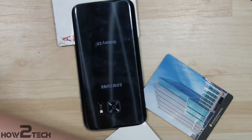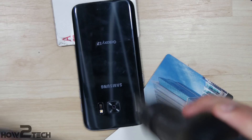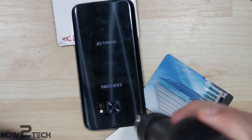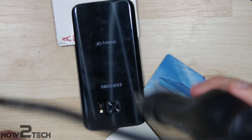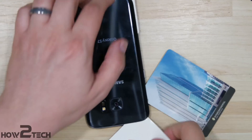Right here there's a bit more adhesive, so you're going to want to heat this area up just a little bit hotter towards the camera area. That'll allow you to slide your playing card just right underneath, and then your back glass will go ahead and pop right off.